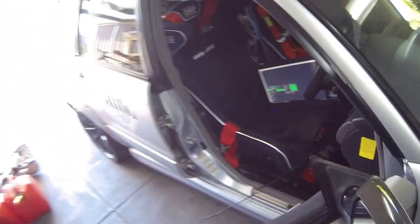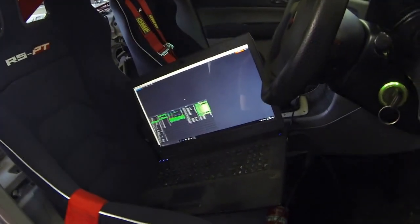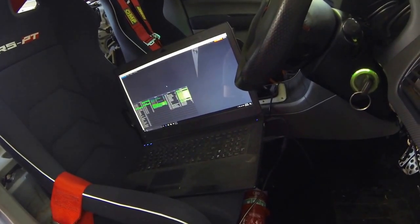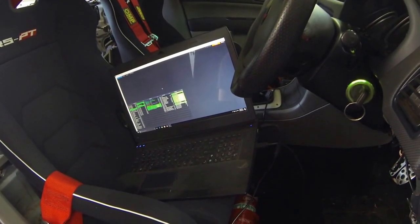So that's how I'll check the timing. Over here I've got the laptop plugged in. There's another step I'm going to do, and that is checking the trigger pattern. That's only because I've wired in this ECU and analog sensor — I could potentially have had the wires the wrong way around, which would give a backwards AC signal on the crank angle sensor.